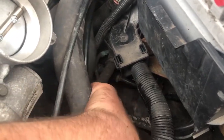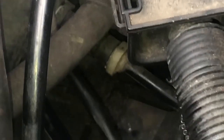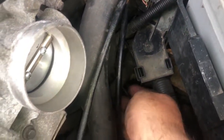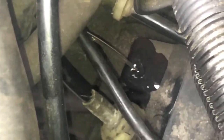Let's go ahead and do the clutch — let's see if this is nice and clean. That little nipple right down there, you can just about see it. There's a metal clip — you've got to pull that up, and then there is a plastic nipple on the end of that, so it's quite tricky to film. I've got that little clip pulled up. Now you can come round to the opposite side — at the end of that black plastic tab there is a nipple. You go ahead and rotate the nipple and that opens it, just like so. And that's sparkling clean as well, which I wasn't expecting.